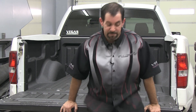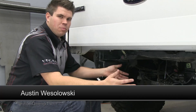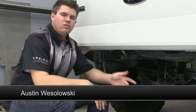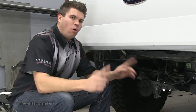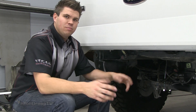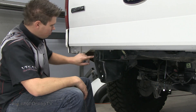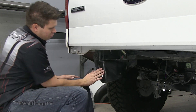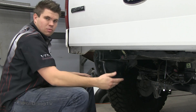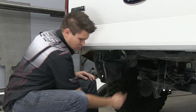Now that our bed liner is complete, let's get going on our bumper. Today I'm going to be fabricating a rear bumper for the F-150. If you watched our last episode, I built a 100% bolt-on front bumper that utilized all the holes in the factory frame for mounting. Keeping with that same theme, I'm going to do the same in the back — use this hole and this hole here on each side of the frame. All this extra frame rail needs to be cut off because we want to increase our ground clearance, so that's the first step in building this rear bumper.